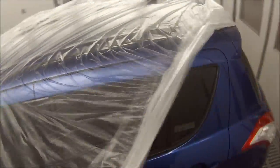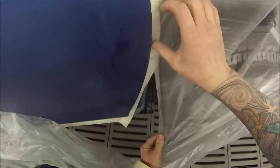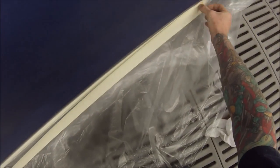It's important that you get this plastic up the right way because if you get it upside down the paint will actually end up flaking off halfway through. I had that happen to me once when another guy masked up a car for me and didn't take notice of which way the plastic was up. I went in and started painting and halfway through the plastic started flaking all the paint off and made a big mess. Learn from my mistake — always check that what other people have done is correct.